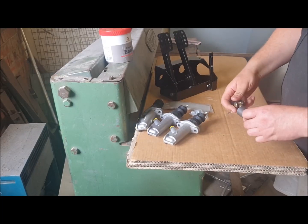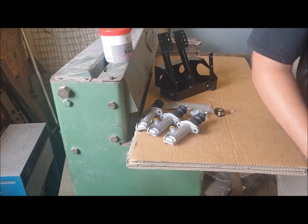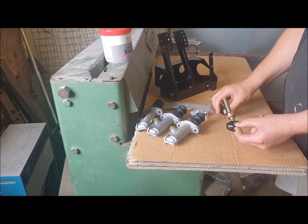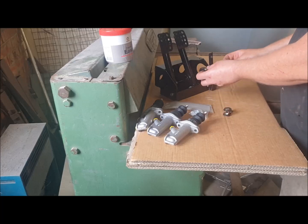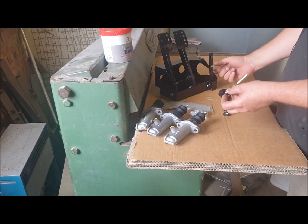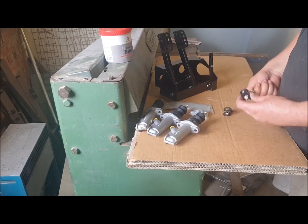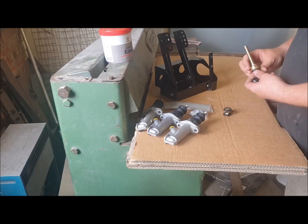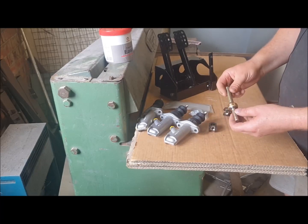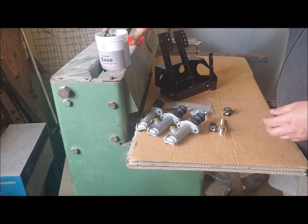The first thing we've got to do is put the balance bar in. You'll notice that it's got one short arm and one long arm. The long arm we will put to the throttle side, because you can put an adjuster on it so that you can adjust it from the dashboard — which is not allowed on the kit car. So the first thing I'm going to do is put some copper slip on these threads to make it easy to thread it up and down and adjust, and also makes it a little bit easier to assemble.